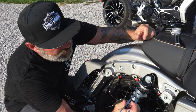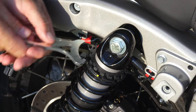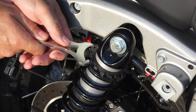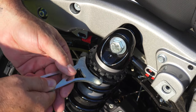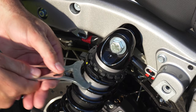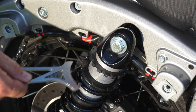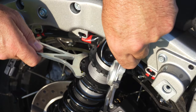All you've got to do is go clockwise on the adjuster ring — going down toward 30 millimeters, which is well over an inch. They do have yellow lines on both the lock ring and the adjuster ring so you can count the number of turns. I'm doing it by distance as the manual says. I can't believe Harley shipped this the way it was — it was seriously hurting my back. This should be turning very easy for you. Taking a measurement: I want 30 millimeters. Almost there — passes through, it's at 30 millimeters.